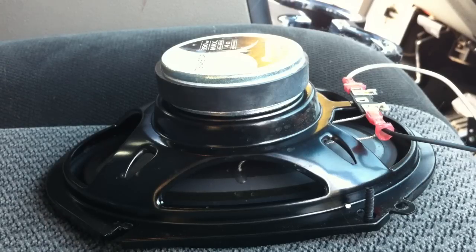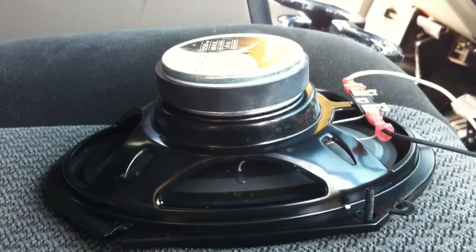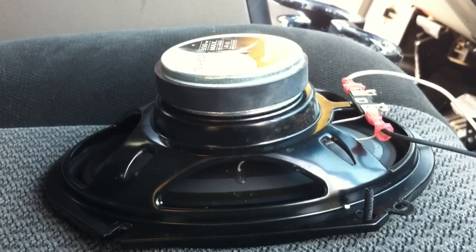As I mentioned earlier, I'm not actually installing new speakers today — I've already got my speakers. What I'm doing is simply installing a speaker baffle. What that does is it goes over the back and isolates the speaker from vibrations, preventing a little bit more interference. Overall it'll improve the sound quality, and for someone who's not looking for the highest-end sound performance but just wants to hear good music, it's a relatively cheap, easy thing you can do to boost the performance of your front speakers a little bit.